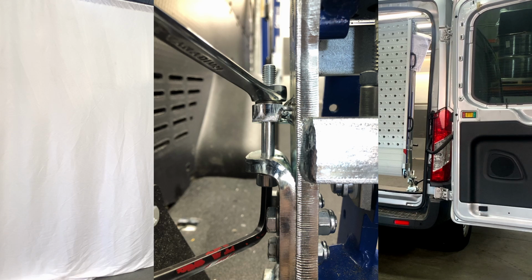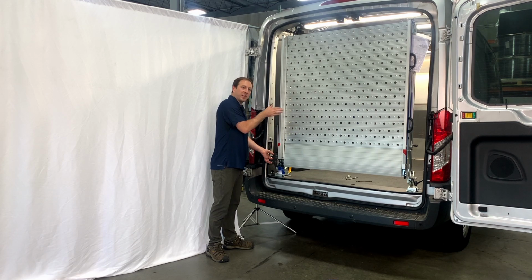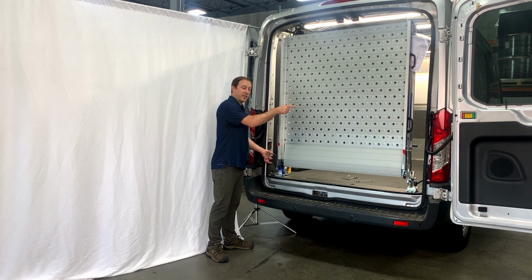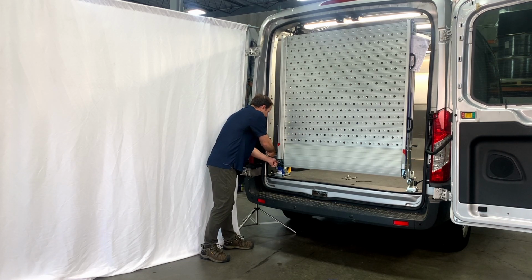And what's happening here is, again, this side on the passenger side was low, and so we want to raise it up by tightening this side, and that'll get that into alignment. If the opposite was true, if that side was floating high, you loosen this to drop it. We're only going to want to go about 1 thread or 2 before checking it, so let's just go ahead here and do that together.